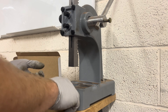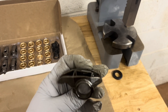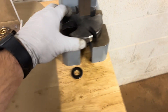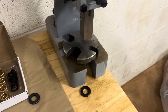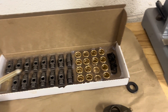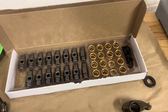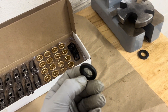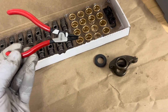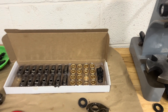Now that we have the stock trunnions out of all the rocker arms and cleaned them up, we're going to reinstall. I'll put a bronze bushing down and press it into one side, put a trunnion in that I've already coated with oil — you can use assembly lube or just some 5W30. Then we'll use the assembly washers to get it pressed in, and then use the snap rings. I've just got a pair of snap ring pliers to put those on — super simple.